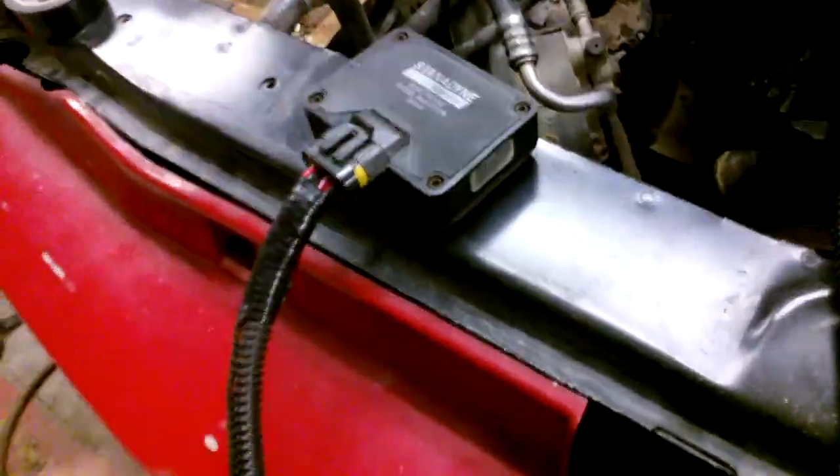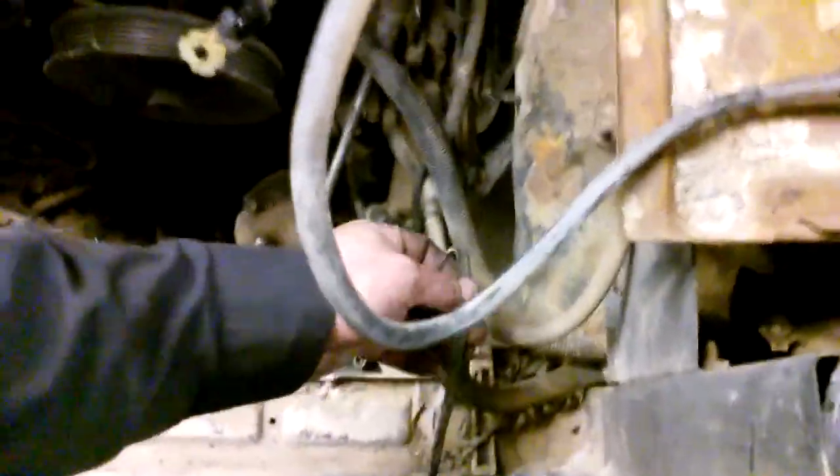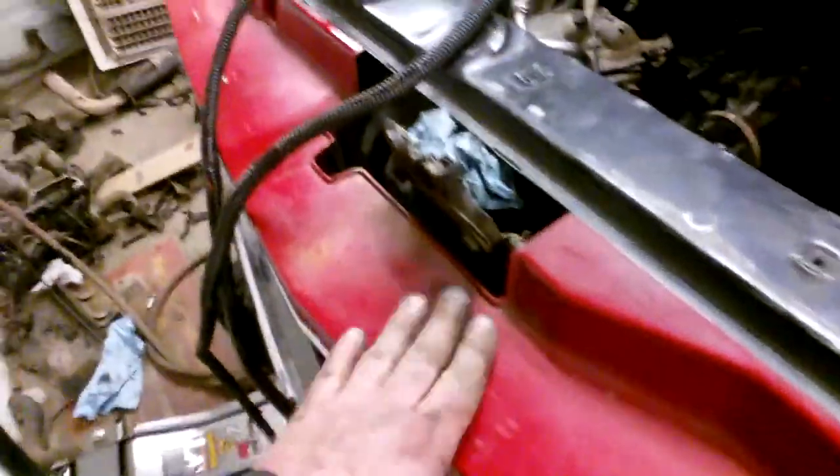One thing I really wanted to cover in this quick video is I went ahead and made my own harness to relocate the PMD, which right now is just standing in my hand. I'm going to route it around once I get everything in here, come out of the same place where the plug comes. After much debate, I decided I'm just going to mount it behind the bumper, behind the license plate like everybody else does — because it's been done, so I know it'll work there and it'll get enough airflow to stay cool.